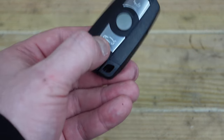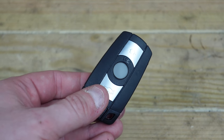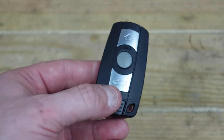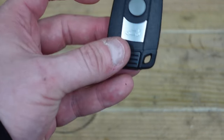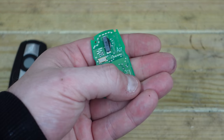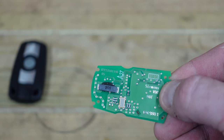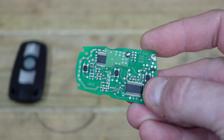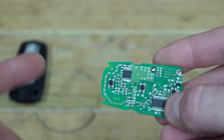If it's blocked, it won't open the car and it also won't start the car — it doesn't mean there's an issue with the battery, so don't think you need to change the batteries. If it's not starting the car and not opening the car, then the key is probably blocked, or it could be that the board is faulty. The only way to find out is by checking with specialist software. The majority of the time on these though, it is the battery come loose from the board. You can re-solder them yourself — I've got a video showing you how to do that. These are the EEPROM chips, which you would use to erase all the data on the actual key itself.